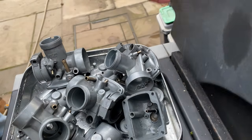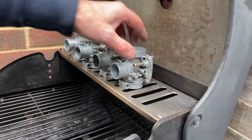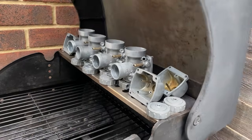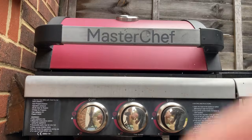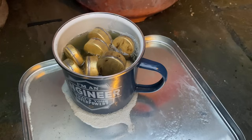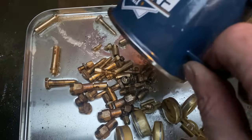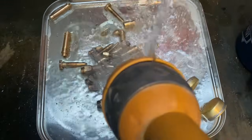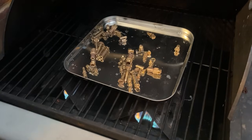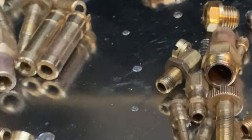The next thing I do is put them in my barbecue to dry them off — it's important to dry them quickly so that corrosion doesn't start to occur in the very small passages and drillings, and the barbecue is just the perfect thing for this. After about five minutes the aluminium parts are done. I come back through the house and there's no smell of cooking because Tracy's gone shopping for shoes and she'll be gone for hours. I then go back outside to get the brass bits — they've cleaned up amazing! I rinse them off with the hose and put those in the barbecue to dry. The clock cleaning solution really works well on the brass and they really do look like brand new.